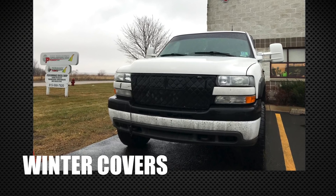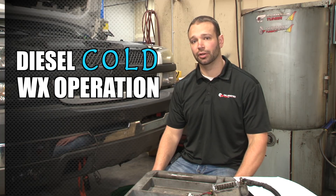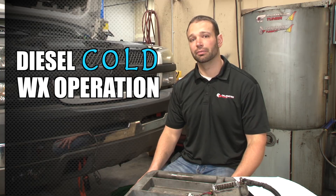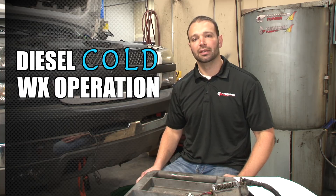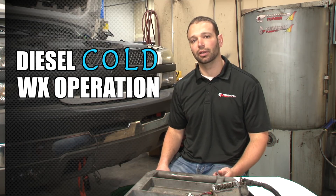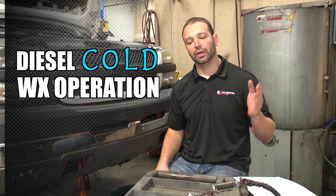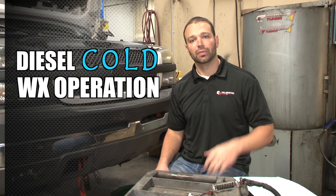A quick note about winter covers — definitely a nice thing to have, especially if you do a lot of unloaded driving in really cold conditions. I will say that after extended idle periods, under-hood temperatures can get really hot. You can see inlet air temperatures of 150, 160, 170 degrees — you can start to smell plastic on some of the newer trucks. So if you get to that position, maybe drop the corner on your winter front. But all in all, it's a nice thing to have. Anytime you can keep the engine coolant temperature up, your mileage is going to go up. We get a lot of calls in the winter about mileage going down — the fuel has less energy content, most people are letting their trucks idle longer, and a diesel consumes tremendously more fuel while it's warming up than when it's at peak operating temperature. Anytime we can shorten the time between startup and ideal operating temperature, that's going to benefit your mileage.